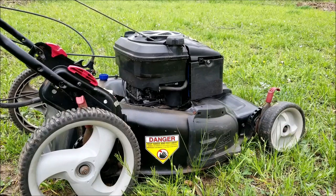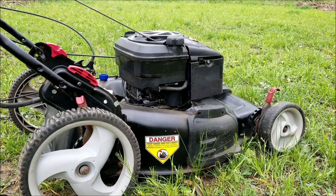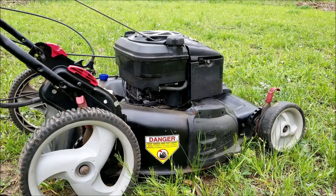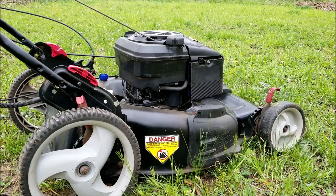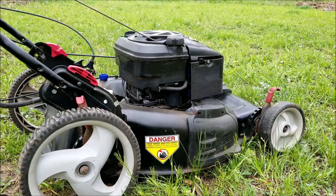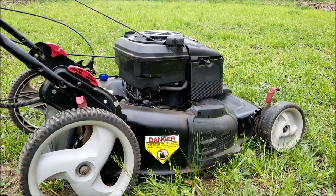It sounds great and the self-propel works! Aside from having some bald tires, as long as we keep using treated 100% gas in the mower it should last quite a long time. My question is: would you have tried replacing the seat like I did in this video, or would you have just replaced the whole carburetor? Just to let you know, I have had issues come up from replacing just the seat and ended up replacing the carburetor in the end. Thank you for watching — please feel free to ask any questions and I hope to see you in my next video.